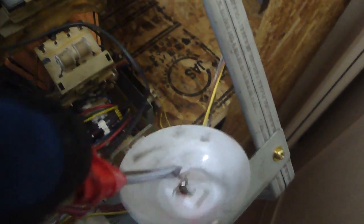We have our grounded wire connected to the chassis. We're going to slide the screwdriver up underneath the anode cap. Push in on the wires — there's one wire disconnected — then from the other side pop the other one out. You can see the cap came off. There are the two clips for it.